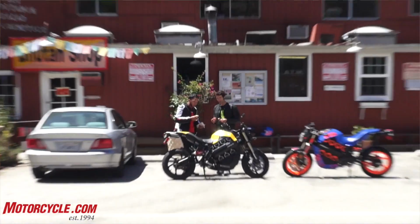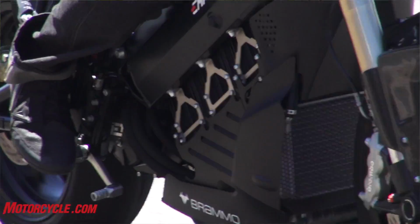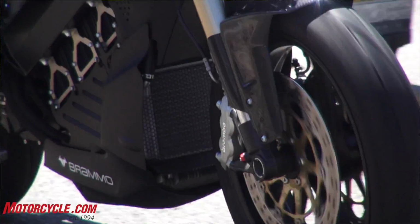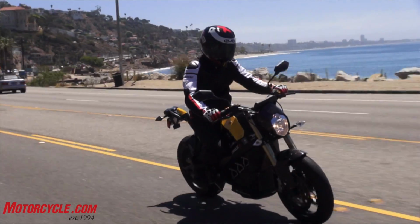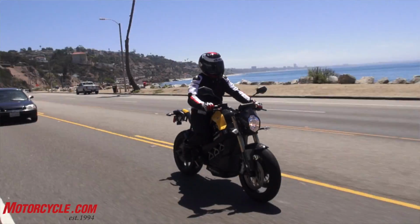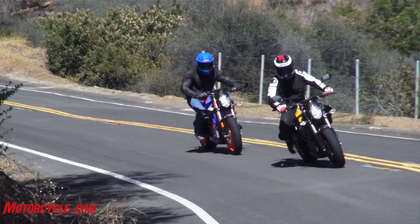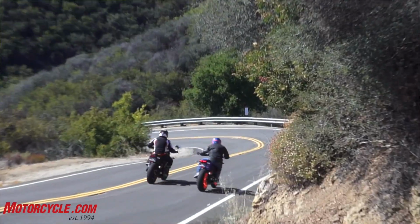And it's free. An important point I forgot to mention earlier: the motors on these things are liquid-cooled, which, if you haven't ridden an electric motorcycle before, there are a lot of air-cooled motors on electric bikes, and those overheat really fast. And when they do, you get thermal cutback, which means the power gets reduced a lot, and the fun pretty much suffers as a result. These, like we just said, all-day hard riding, liquid-cooled motors, no thermal cutback. Yeah, you can enjoy that power all day long.